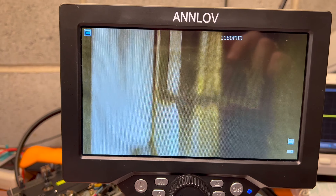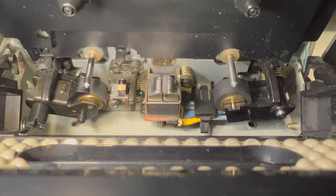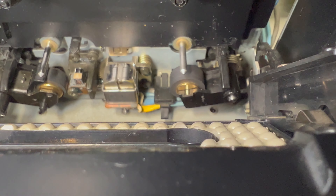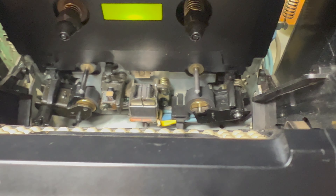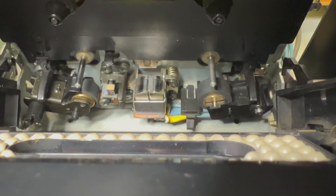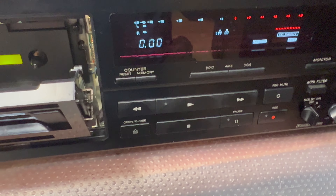Okay, let's install it and listen to what we get. That's how the polished head looks in the deck — it shines like new. I'm happy with the results. I was able to fix the frequency response in this deck and it currently records and plays perfectly. I've already sealed the position of the head. I verified that recordings on all tape types from this deck sound brilliant on my Pioneer.